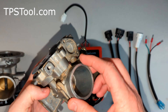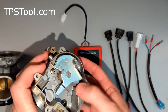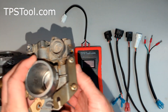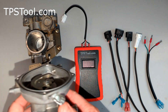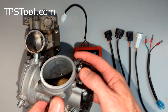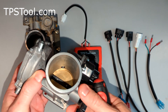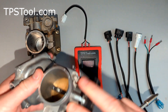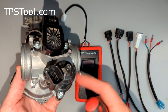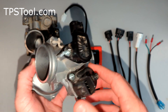There's the screw and that's a pin that holds the throttle open. On these older engines that's actually part of the adjustment. On the newer ones the ECU controls the idle using this — it's called the idle air control valve. You can see there's a hole here where the air goes in and bypasses the throttle plate and comes out here, and this is the valve in between that controls the air. If the ECU wants the idle to be up or down, it'll use this valve to control how much air goes through.